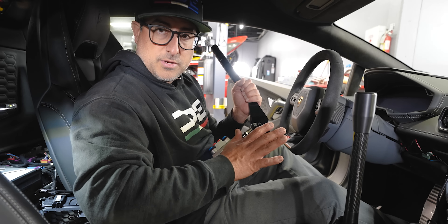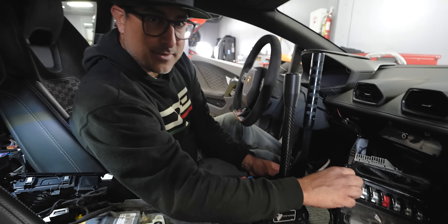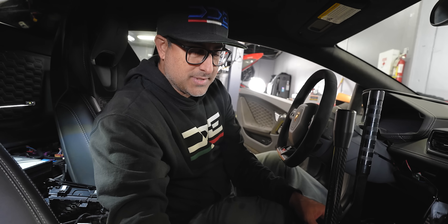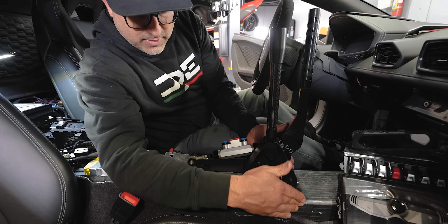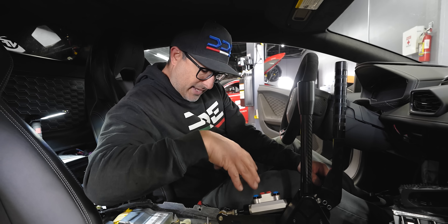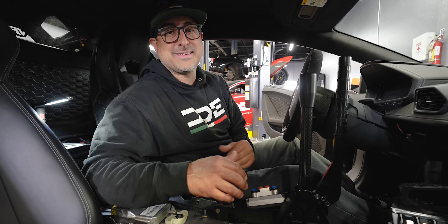The idea is to get this whole thing done, then scan all of it and do a 3D-printed center console that we can wrap. All these electronics are literally held together with 200 mph tape — that needs to get addressed, but that's something we'll have to scan and 3D print because making it out of metal would take tons of hours to look nice. First step: now that we've got the position, I'm going to take measurements and draw up the template, get all the dimensions from the bolt holes, and decide if I want it to stretch out front to rear. This is going to be a single flat piece that sits on top and bolts down. Maybe a day and a half to get it all done, and that'll be in this video.